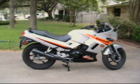Just some of the specifications of the bike. It's 80 inches overall length. It's basically 28 inches wide. Its dry weight is 304 pounds. It's very light, and one of the nicest things about it. It's got a 2-cylinder, 4-stroke liquid-cooled engine, 250 cc's displacement, electric starter, and a 12.4 to 1 compression ratio. Even with that high compression ratio, it still runs on regular, which is really nice.